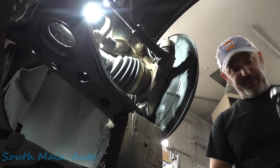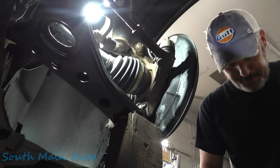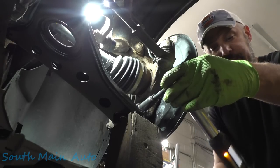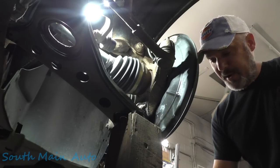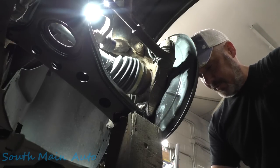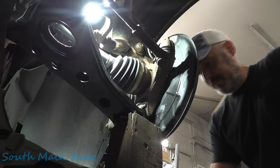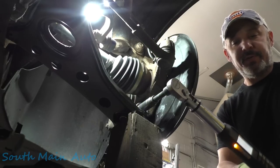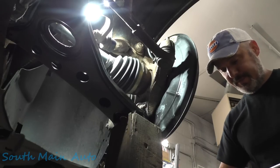For all the torque Nazis, we'll grab ourselves a torque wrench. We're going to go 26 foot-pounds — I'll have to go verify that, I probably need to grab an extension. So we're going to go 26 foot-pounds. And then we want to go another 35 degrees beyond that. We'll let our torque wrench calibrate here, and we're going to go an additional 35 degrees. Putting our total torque at 457 inch-pounds.